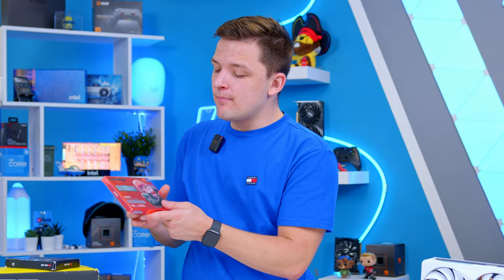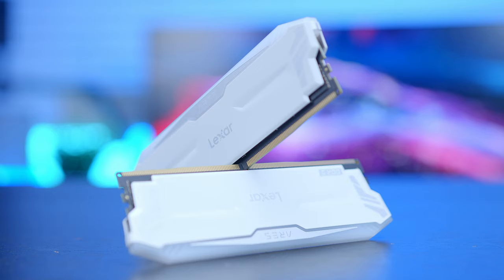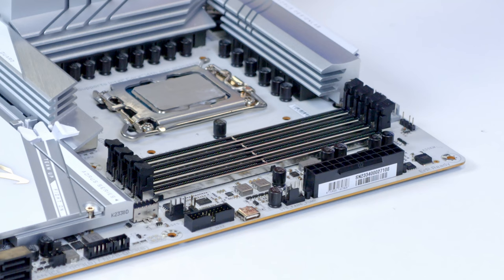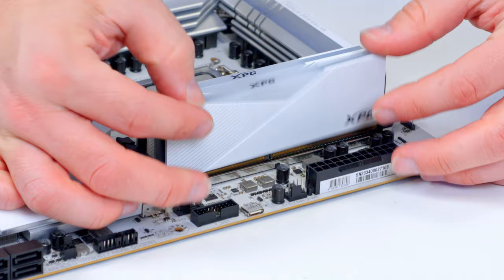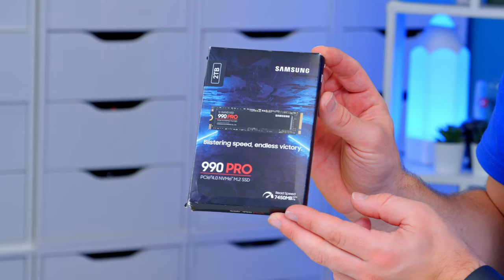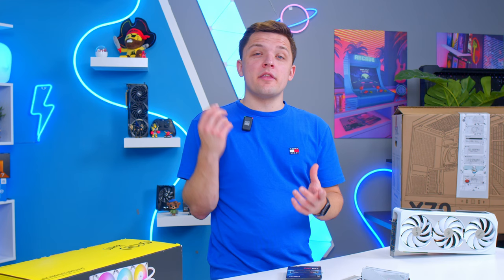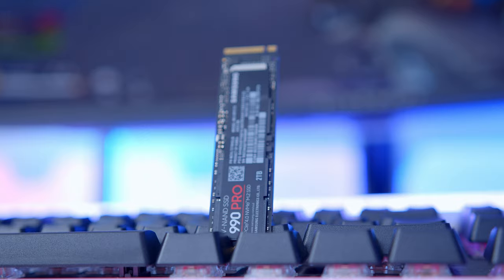As far as RAM goes, a couple of options for a gaming build. 32 gigs is going to be absolutely fine. This is the XPG Lancer kit — I really like this kit. Corsair obviously have their Vengeance in white, and we've also tried Lexar's white DDR5 kit. There are no shortage of options if you're trying to tie into the colour scheme, but I like the way the RGB works on XPG's memory. Two 16GB DIMMs is going to be absolutely fine. If you want that extra RAM bandwidth, just pick up two packets so you've got 64GB. Lower latency is obviously a lot better with DDR5, especially compared to its DDR4 counterpart. Next up, it's time for the M.2 drive — aesthetics here aren't quite as important because it's going to be hidden. I've gone for a 2TB Samsung 990 Pro. It delivers really great performance and is one of the best-selling Gen 4 NVMes for a reason, but it is a little bit more expensive — about $20 extra for the 2TB versus the closest competition. There's definitely a bit of a Samsung premium there. I think it's a high-quality drive and worth the extra cash, but it is not the best value option at this price point.